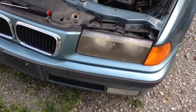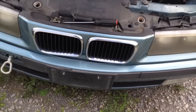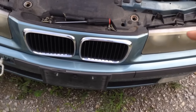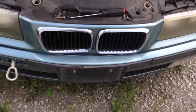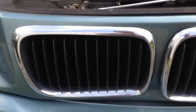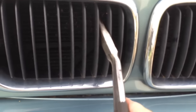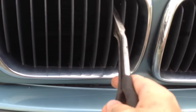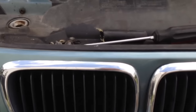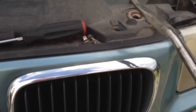So let's say that's not the case and your latch is broken either up here at the latch itself or something happened to the cable where the passenger side won't release. I'm not going to physically do it because I don't want to break these grills — they're in there nice and tight, which is pretty rare. You may not have to do that. There's a cable that runs across from latch to latch — it's only about two feet long — and you could actually see the cable up in there. Get a pair of long needle nose pliers, or a bar with a hook, or even a coat hanger. Go up in here, grab that cable and pull on it — that's going to release that latch and even the driver's side too. So even if you're broken on this side of the latch, you still have a chance of pulling the center cable to release it.